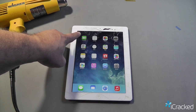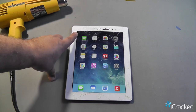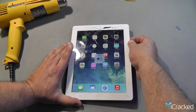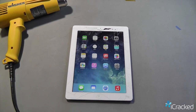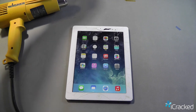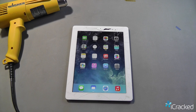Also make sure you have a good WiFi signal or your normal signal depending on your situation. Make sure that the volume up, volume down, and mute work. If you have a smart cover, make sure the mag sensor works also — in this case, I'm just using a magnet, waving it over, and you see the screen goes to sleep and wake up, which tells me the smart cover sensor is functioning.